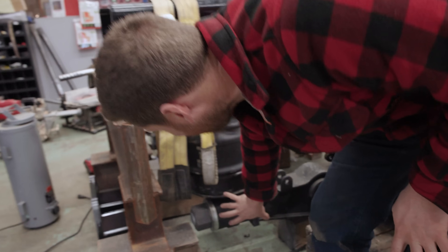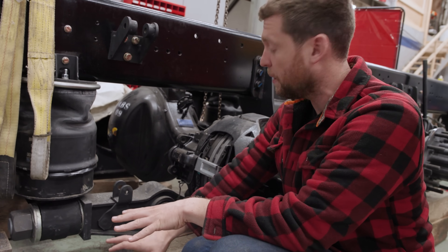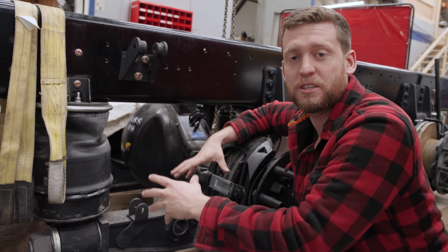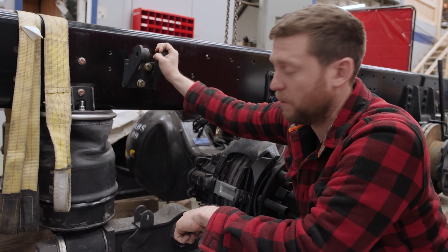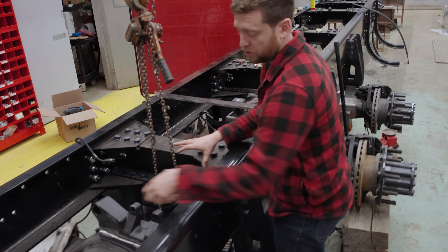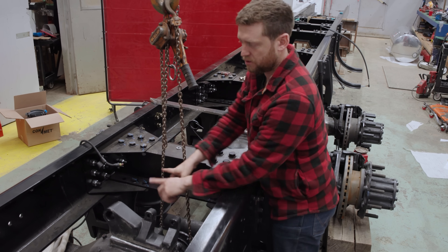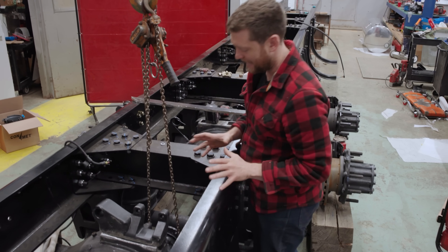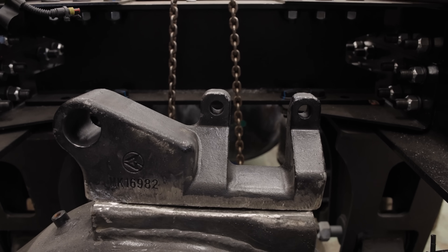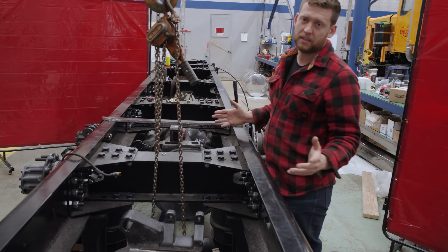You can tell this is a much more Skookum design. It's a little bit more expensive, but I've driven trucks with the New Way AAD suspension and it rides nice — it packs the weight well and handles the abuse well. Everything on it is just a little bit beefier. One more thing: the style we went with is the older school style, just one torque rod to the front and one torque rod to the side. The newer New Way AAD suspension has a wishbone design — one pin comes out and splits into a Y. I've had those trucks before and it ends up blowing out those bushings. With this classic style — one single torque rod each direction — I've had better luck and fewer bushings go.